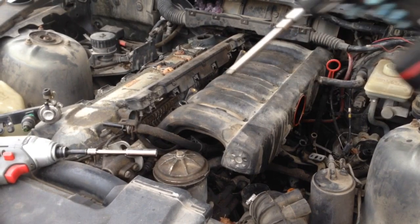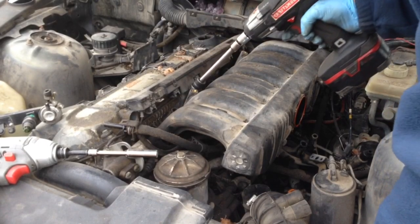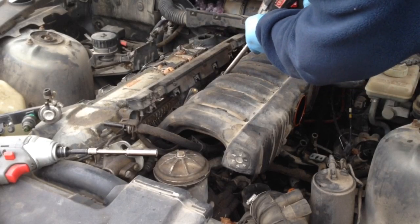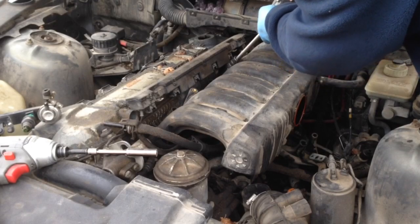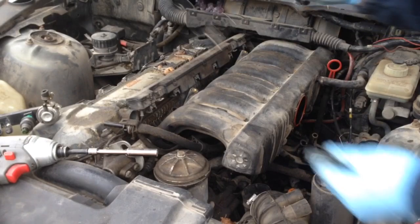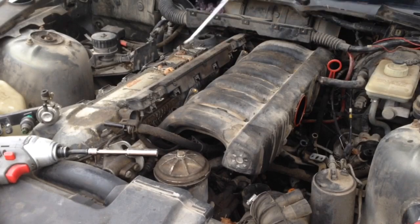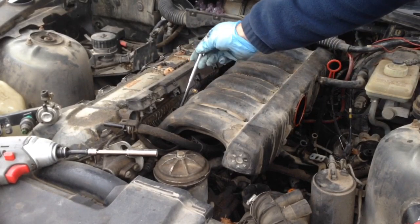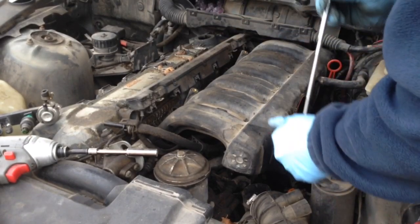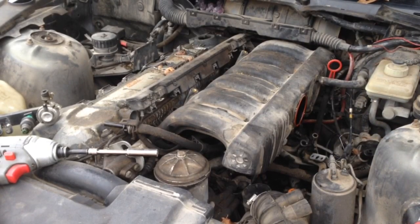In this case I don't have a deep 11mm in 3/8 drive, so we had to use a 7/16. We're going to zip this stuff off. Before we go any further, take the magnet, reach it in there, and pull the nuts out. On M52s there are openings where nuts can fall down - in that case put the magnet next to the nut when you zip it off so it doesn't fall and you don't lose it. If you have extras it's not a big deal, but if you don't it could be quite the problem.